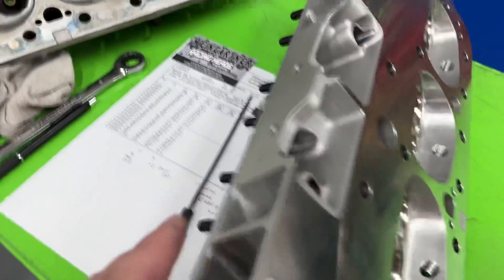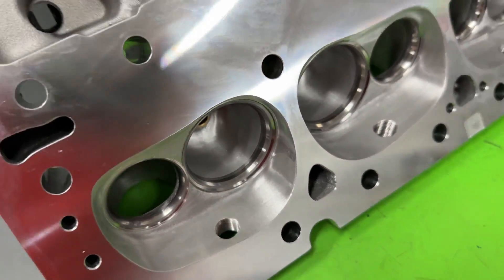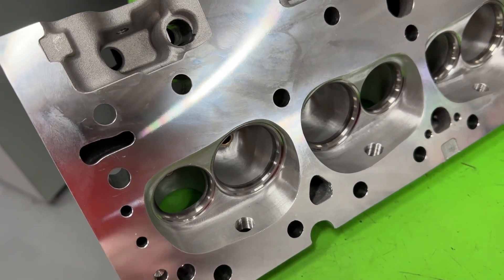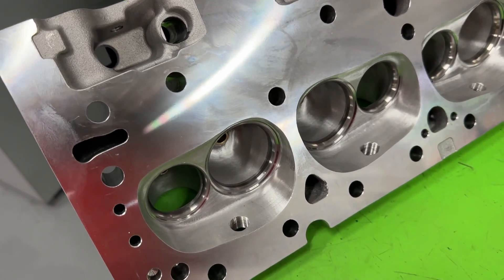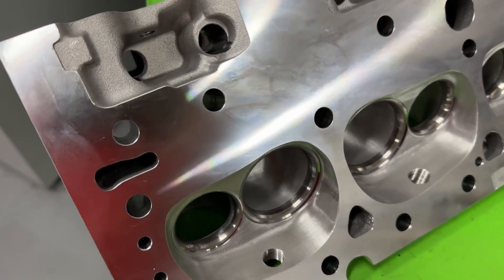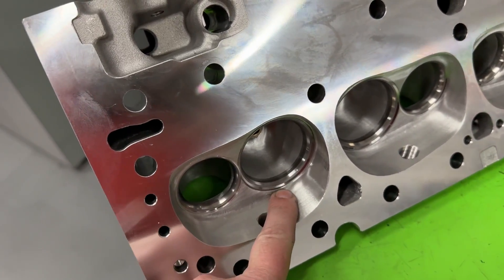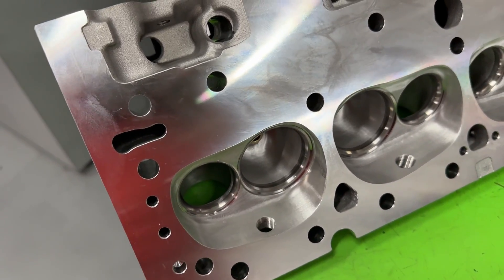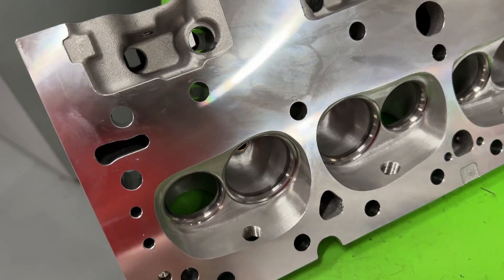A cheaper seat material is what's in this E Street head. They look nice and shiny after being cut, but they're hard to cut because these are a powdered metal seat — very hard. You would think that's great, it'll last longer. Yeah, but it also beats up the valve more, because one thing's got to give. I hate machining these every time. Even with my new seat guide machine, your cutter better be sharp or you're not going to get a round seat with these.